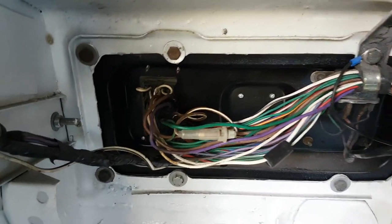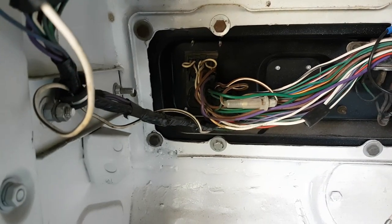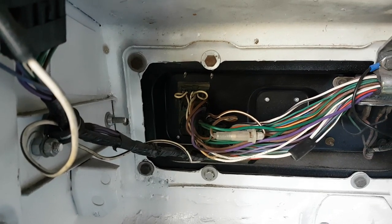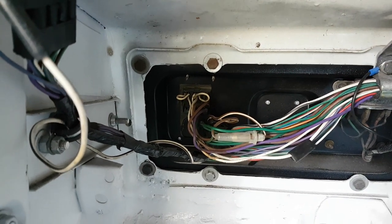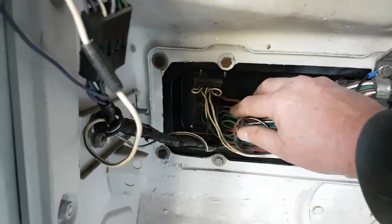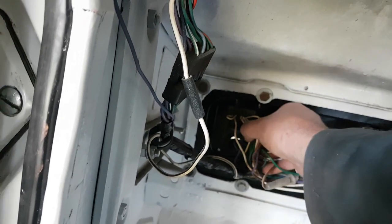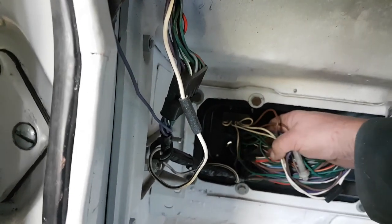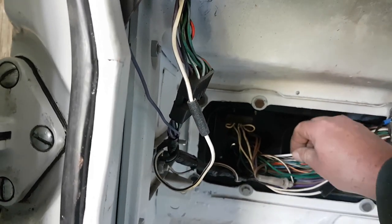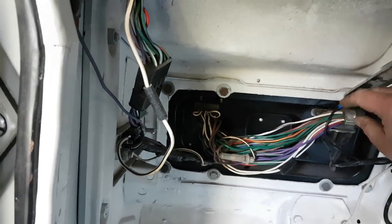So all the other cars have a wire that goes from each of the fuses, goes back to the ignition column and plugs into that little white wire chappy there. So I've got to the bottom of it. Not quite sure why it exists, but it does. And it does help me understand why one of those fuses is dead. The other thing that's interesting is every single one of the other cars, these two fuse positions are the other way around. So I suspect it has been tinkered with. I don't know why it's been tinkered with, but it has been tinkered with. Red and white. Just check there's no other loose white wires in here. It might have been one that I pulled out, of course.